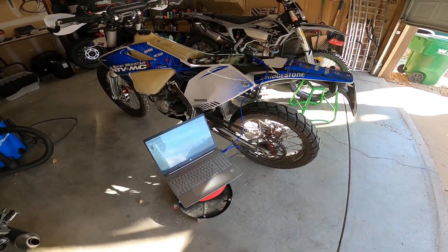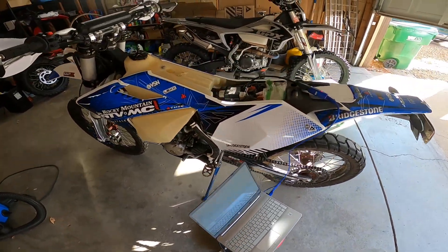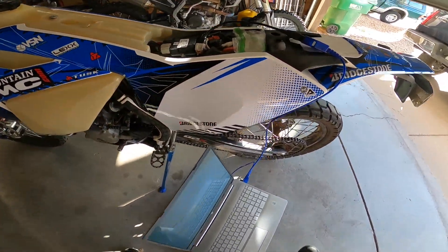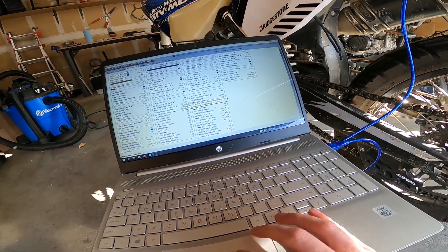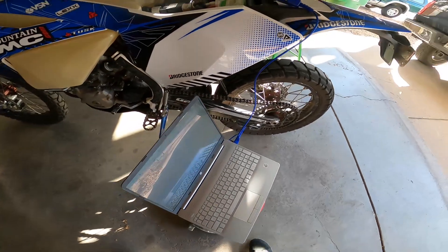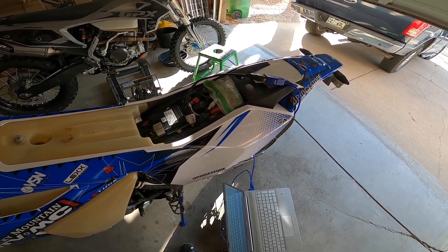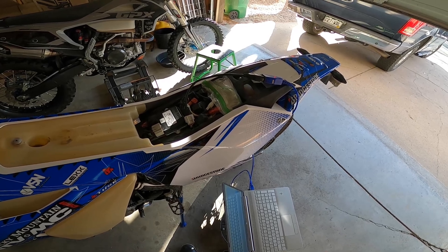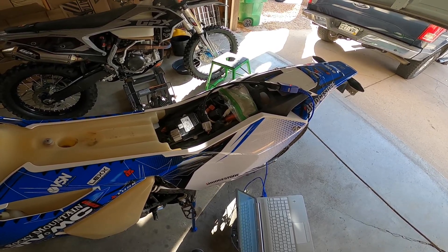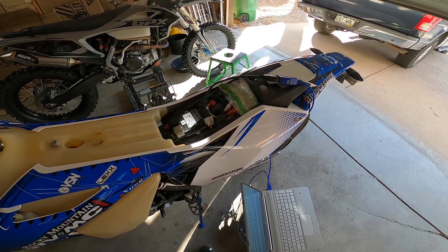Real quick — I wasn't going to do this, but I changed the AFR altitude compensation settings, flashed it over, and now we're going to restart the bike. The problem is, since I just started it 5-10 minutes ago, it's probably going to start right up. My air fuel should be higher, but it naturally is after a startup because when it's really cold it makes it really rich. Right now it should come right alive — I don't expect any issues. There we go. Easy peasy. Got to let it cool, and then we're going to test some more and see if my changes did anything.